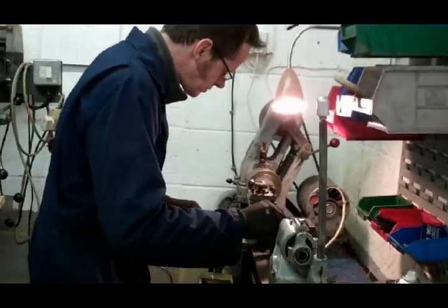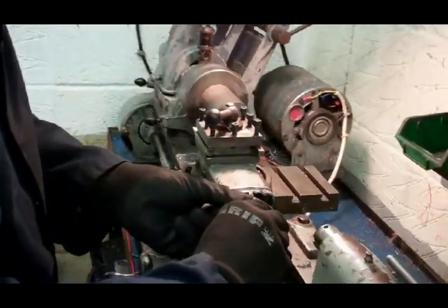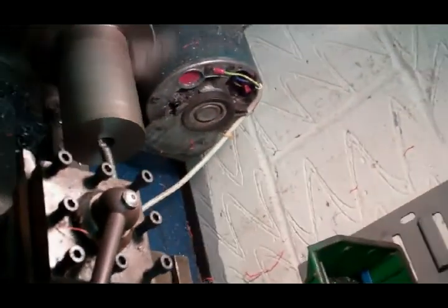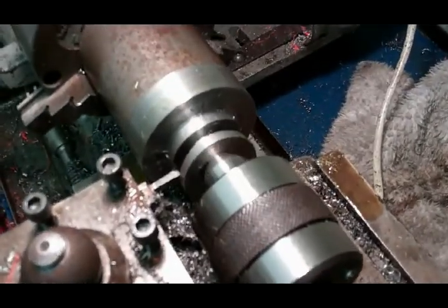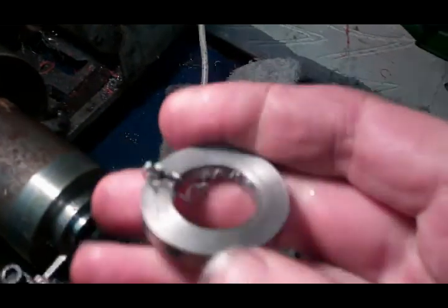I've oversized the frame width, so now I'm just making a spacer. Here we are just boring out a large lump of steel — possibly a bit of a big lump of material to have in a Myford 7 without a steady, but I haven't got a steady yet, I'll get one later. Anyway, this is boring out the beginnings of the spacer, and this is just finishing it off — five minutes later, or five hours.